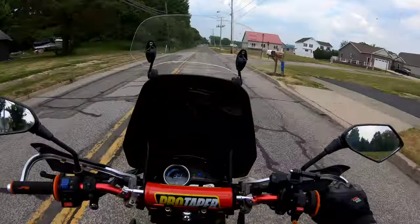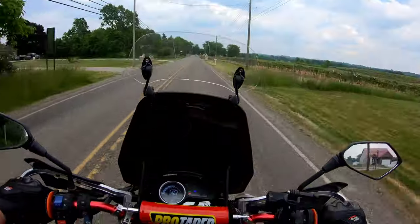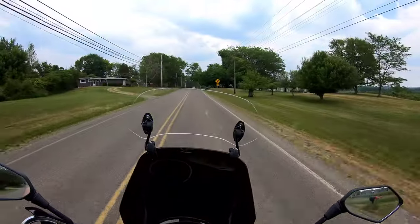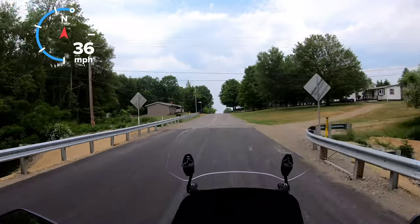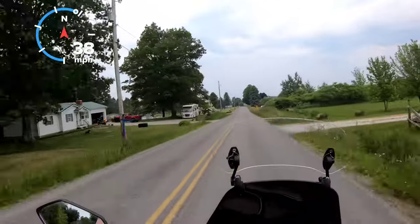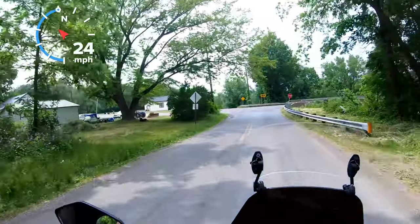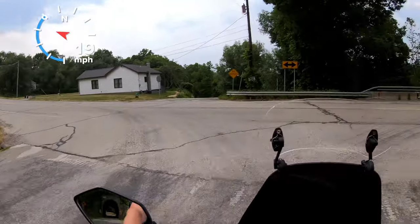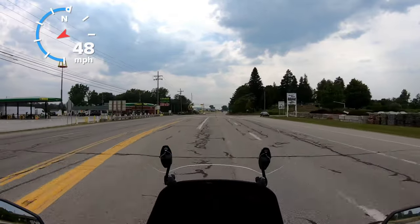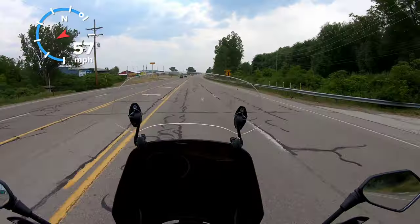We're going back out to do the exact same run we did earlier. I'm in third gear going 39 to 40 miles an hour — normally I'd already be thinking about fifth gear. The bike's only at about 6,500 RPMs — we're not pushing it. I definitely have to relearn my shift points. I need to keep it in fourth where I was doing fifth gear earlier. It'll be a learning process. Heading out to the road — hopefully no state troopers again.